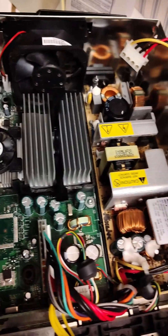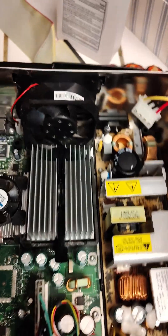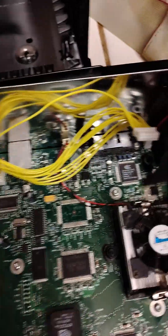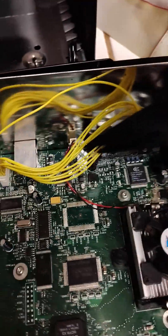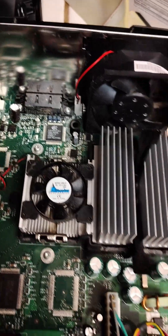The hard drive is already ready to go. Now what we want to do is go ahead and unclip all the stuff. Your best bet for this is to get a pair of pliers and yank it out. You want to go ahead and unplug the GPU fan here. This is for the IDE — we can probably unplug that too. This is the GPU fan.